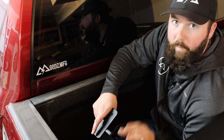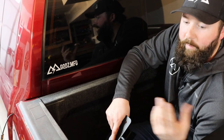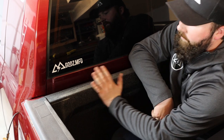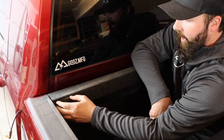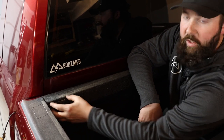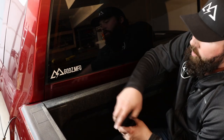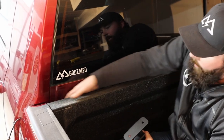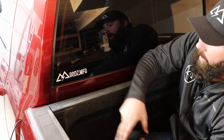At this point we've loosened the bolts on my retractable cover and slid it back — you can see I just have enough shoulder width here, we didn't move it very far. On the front of these RAM trucks we have this little 90-degree bracket, and I'm going to use that as my locator. Since I'm installing two of these today — one on the driver side, one on the passenger side — that way I know they're relatively even and I don't have to bust out a tape measure. If you don't have a feature like that on your front bulkhead, go ahead and measure it. You can put these wherever you want; just be mindful that there's nothing back there you're going to hit when you start to make your drill marks.